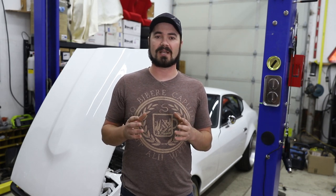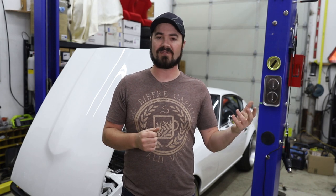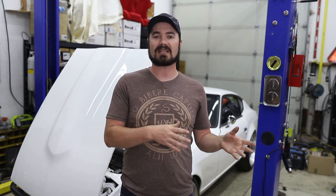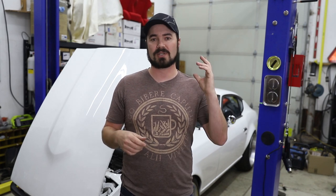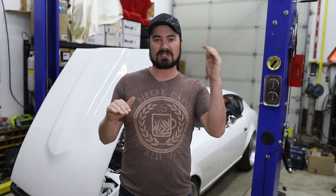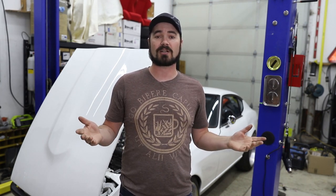That's one of the best things about this system: I can see the actual load. And when you set up something, for instance, a 15 amp circuit, it's 15 amps continuous. That's the maximum usage continuously. You can set the inrush to over 100 amps when it first comes on. So when your windshield wiper first comes on or the electric fan first comes on, that surge doesn't count toward the total maximum for that circuit. As soon as the inrush is over, it then starts sampling to make sure it's within the continuous running guidelines. Almost everything on my car required way less than I actually thought based on what fuses were assigned to it.